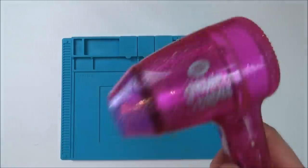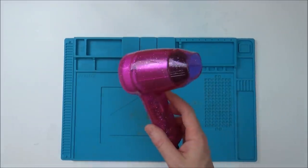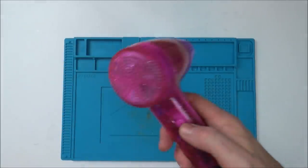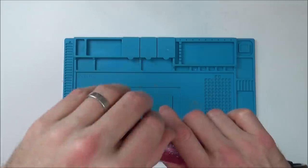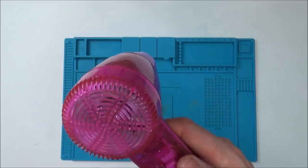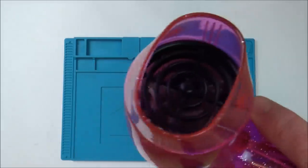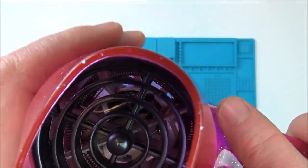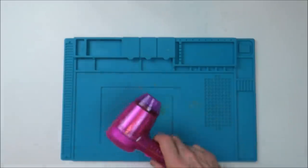Let's turn it on. I'm hoping it will become faulty for me and then we'll take it apart - it might be an interesting one. Success - it was on for about two minutes and then it turned itself off. I wasn't covering up either end, so two minutes is not very long to dry your hair. It does feel very warm. Now it's not working, so let's unplug it, take it apart, and get some measurements. I can see there's like some massive kind of diode thing in there - maybe that thing is failing once too much heat goes on it.